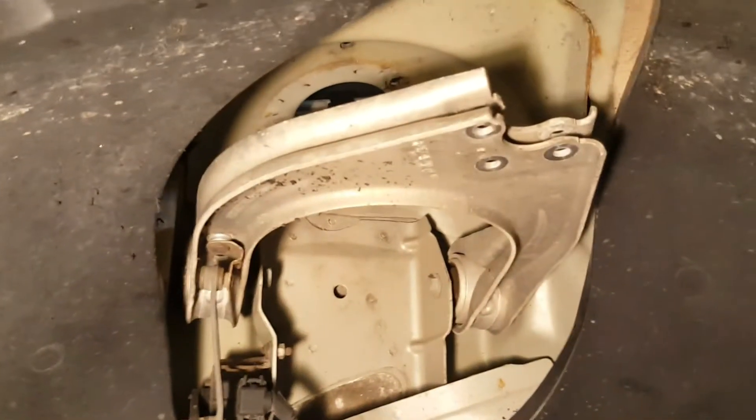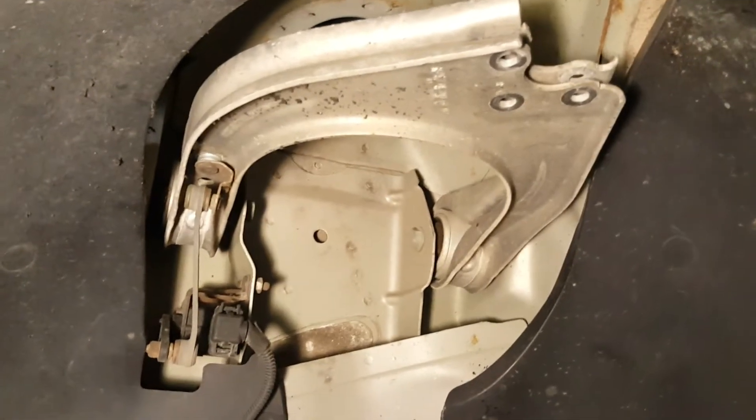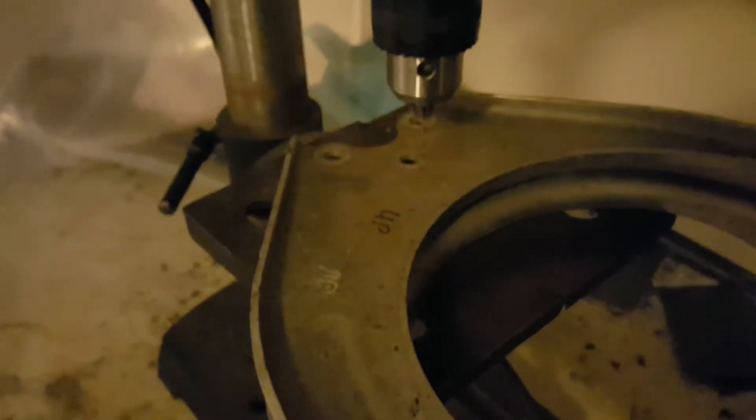With the strut out, the next step is removing the upper control arm — not necessary for the coilover install, but I want to add more negative camber to the front suspension, so I need to drill the holes out. On the last track day, most of the tire wear was on the outer wall, which indicates not enough negative camber. So I'm increasing the camber by about another degree — currently at 2.3 degrees, this will take it to about 3.3 degrees. Increasing front camber also helps reduce understeer, which the car was doing on the last track day.